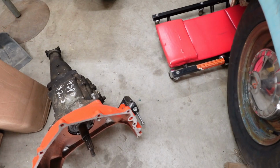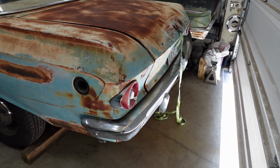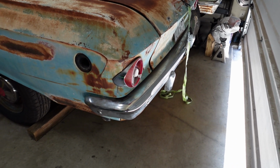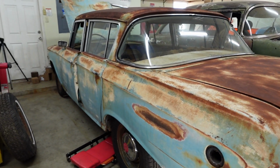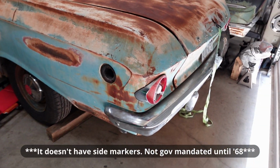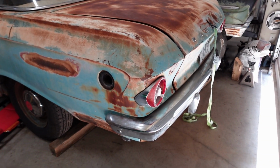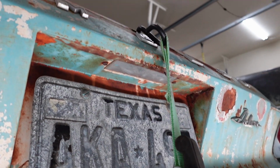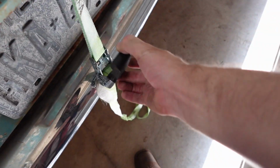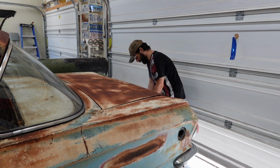Yeah, I shouldn't be walking backwards through here. I just wanted to go only halfway out with the headlight switch, which is for your marker lights, your marker lamps, which this car doesn't really have because it's pre-67, but the tail light should still be on, and our license plate lamp. And actually, here, let's get this off because I know that the bulb is just hanging in there.